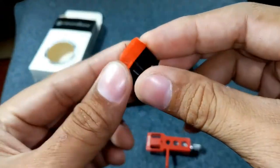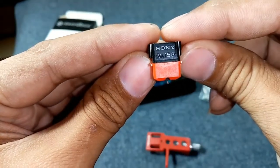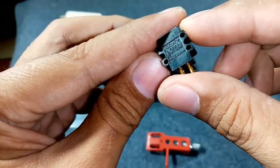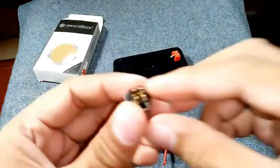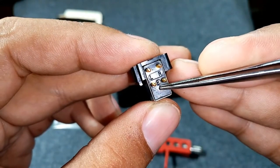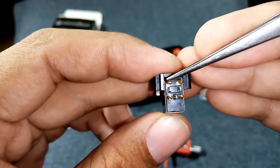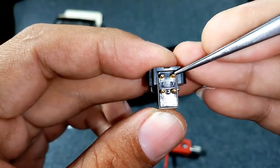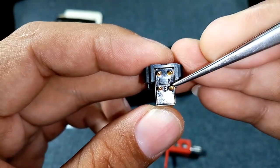I'm going to mount this Sony VL-15G stylus, needle, and cartridge. I'll remove the stylus to be safe. Let's check the pins — left, right, and the letter E. Letter E stands for ground. So there are two ground pins. The left channel positive is white, right channel positive is red, and the ground pins are green and blue.